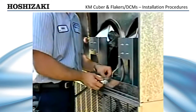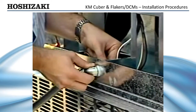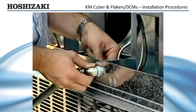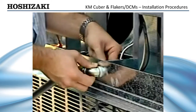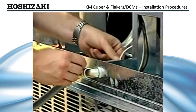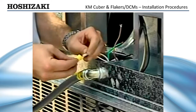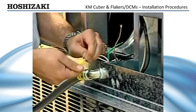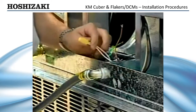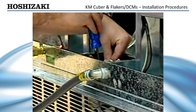The fan control wiring from the ice-making unit requires a three-wire circuit. To connect this circuit, first remove the louver panel and junction box cover from the condenser unit. This circuit should be routed through seal-tight conduit. A disconnect may be required by local code. Connect the fan motor leads in the junction box of the remote condenser unit to the fan motor leads in the junction box of the ice maker. A proper ground wire is required to prevent possible electrical shock.